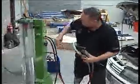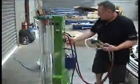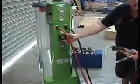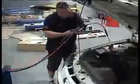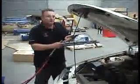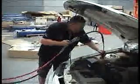We go to the coolant flusher, we turn the air on, we open the valve to the up position, 12 o'clock position. We come over to the reservoir and we open the valve on the coolant drain, which is the black hose. So we open the valve.